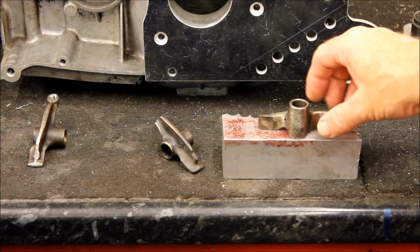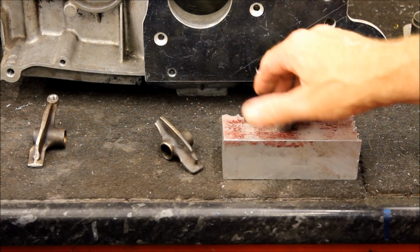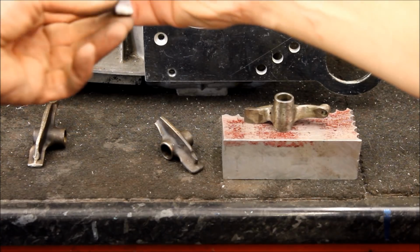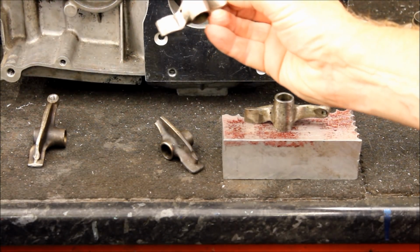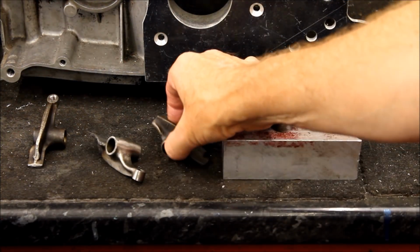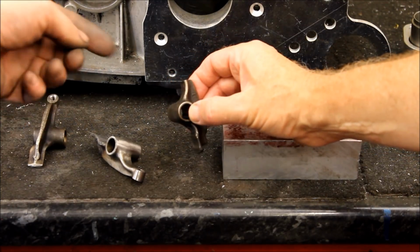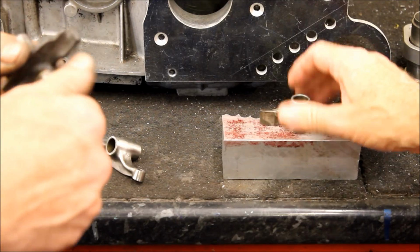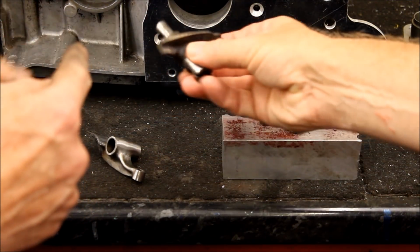And also down here we've got the rockers, or at least some of them. 1, 2, 3, one in your hand. These are knackered. The case hardening's gone on them. Yeah, and also there's one here which is snapped. That is snapped, yeah. You see that? Snapped clean off. But actually what I've got these for is they're the original rocker. This is what pivots.